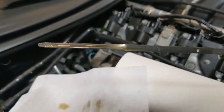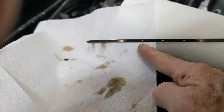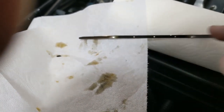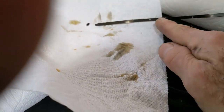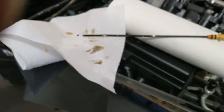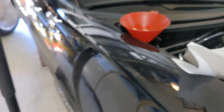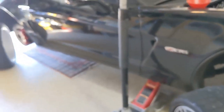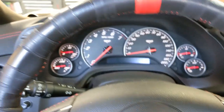I'll finish putting the race tires on. Okay, it's been 20 minutes and I will read this for you. I'm not sure it'll show up on the computer screen, but the level is right there to the first hole, and anywhere between that first hole and the top hole is good. So I am going to add another half a quart, and that'll bring it up and I'll check it at the race on Sunday again. So that's about it — getting ready to put the race tires back on. Give me a thumbs up or a like if this helps you out; subscribe to my channel if you want more from Froggy; ring the bell if you want notifications. Be safe, have fun — Froggy out, bye bye.